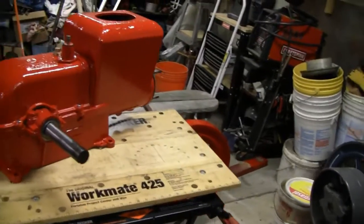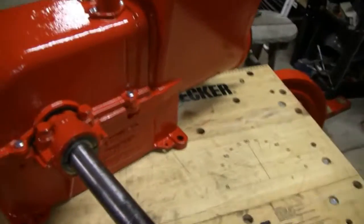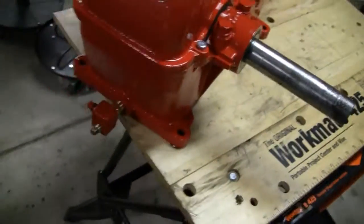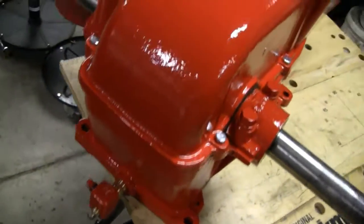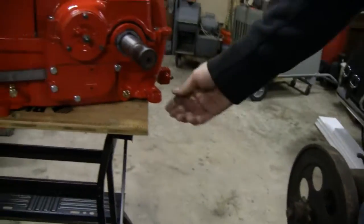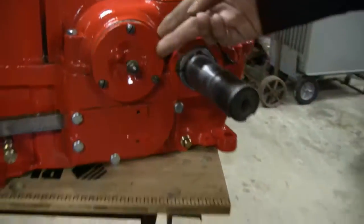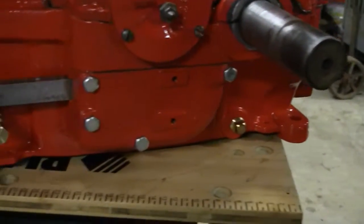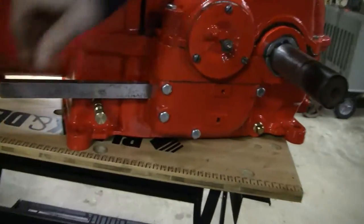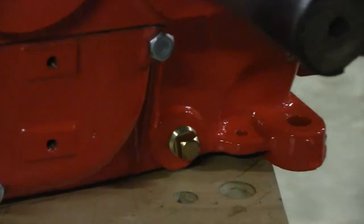Here's a little update on what we got done so far. We put the gaskets on, put the cover back on, got the new brass plug up top, put the drain plug on over here. Over this side, we have a couple covers to put on - the governor cover and then the push rod cover. We got a new brass drain over there and then another brass plug over here. This camera don't like focusing in the dark.